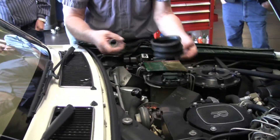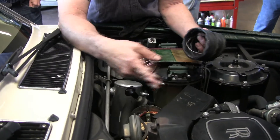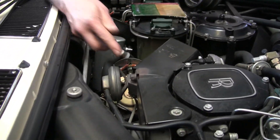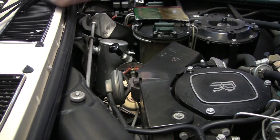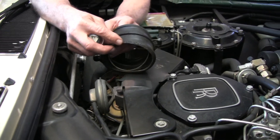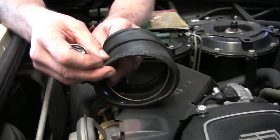This is real common on this model with this EGR pipe up here. This pipe brings exhaust gas up and dumps it into the intake to reduce emissions. It gets real hot here, and this one, as you can see, it's a little blistered — it stayed out in the sun too long.